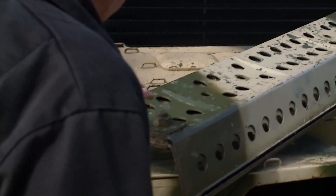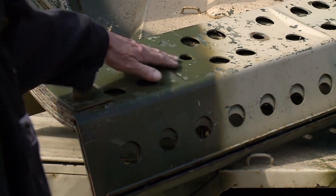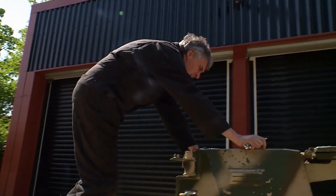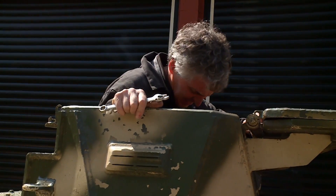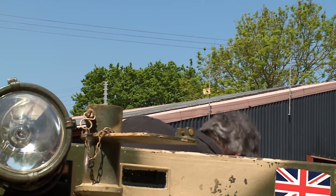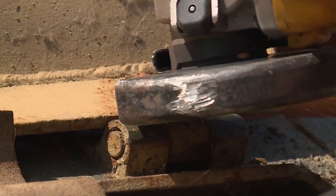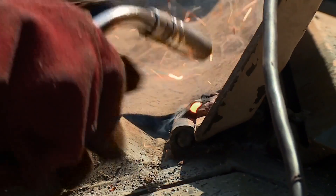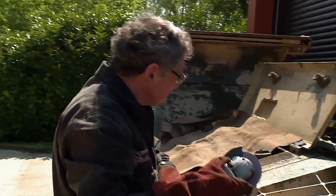We've successfully bent the ferret's sand ramp handle into shape. While that cools, we get on to the next job: welding the cracked hinge on the engine bay door. I'll pop in now and just whip the battery terminal. Wire welding, a.k.a. MIG welding, requires an electrical current passing through the metal being welded. This current can fry a vehicle's circuitry, so I'm disconnecting the ferret's battery. It's an amazing number of people who don't do this — you could destroy the electrics on a car. First off, the cracking hinge will be ground smooth — this will give a clean surface for the weld to stick to. That should bite in quite nicely. At over 15,000 degrees Celsius, welding wire melts against the surface of the hinge, leaving behind a weld that's solid but ugly. To make it look right, I grind it smooth. When it cools, it's ready to paint.